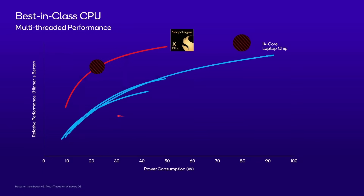Looking at where those two laptops fit on the performance-power curve, the 23-watt configuration is on the lower end of the curve, with greater performance available as you go higher. There seems to be a sweet spot around 40–45 watts, and the 80-watt version is at the upper end. However, this is definitely diminishing returns — going from 23 to 80 watts, and we'll see that clearly in the graphs.